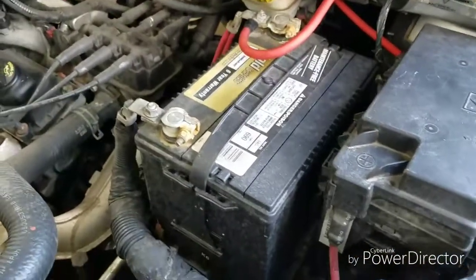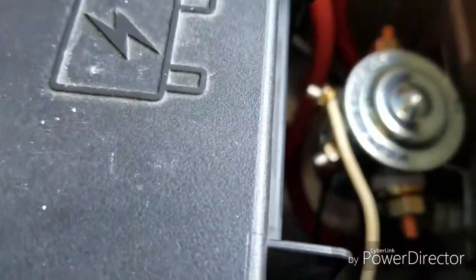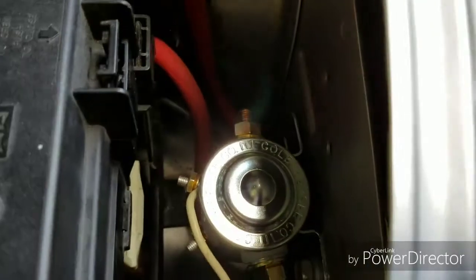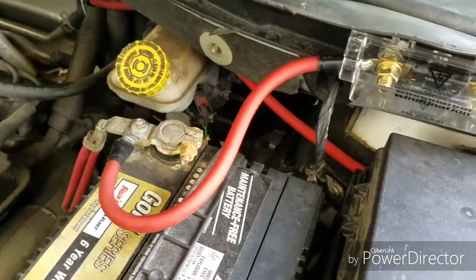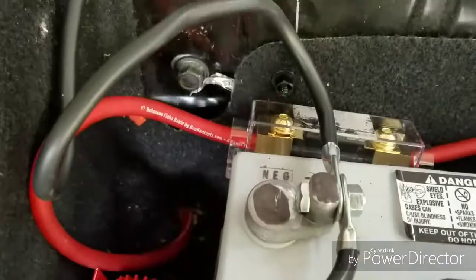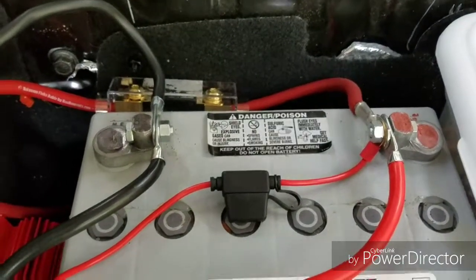Okay, we got everything done. Just to recap, we've reconnected the ground. We got the solenoid here — and there was a lawn mower running so we waited — the solenoid is going to ground. We also have the other wire, the fused 10 amp fuse going into the fuse box. We have one side of the solenoid going into the car battery and it is fused. In the back we have power coming in from the solenoid through the fuse to the battery. And now we have the battery grounded right there.